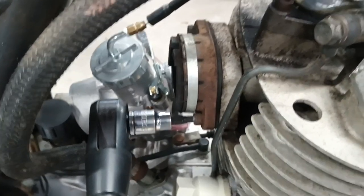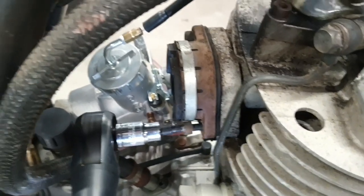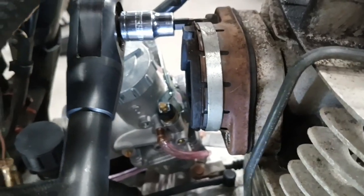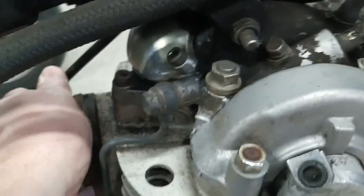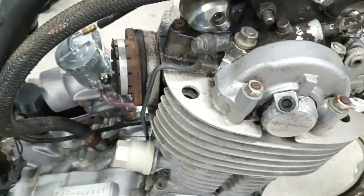Back to work over here. I already got the coil replaced. I'm going to pull the intake boot off. I already took the air filter and the carburetor loose and got them out of the way — that was just a couple of screws and a couple of seconds with the screwdriver. It will greatly improve the looks of everything and allow me to hook the petcock back up to the vacuum system.